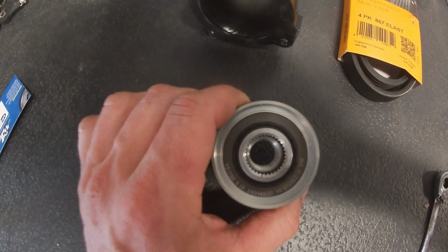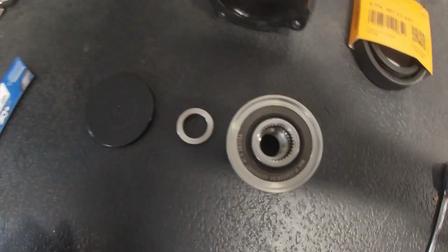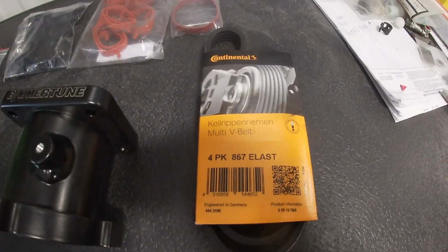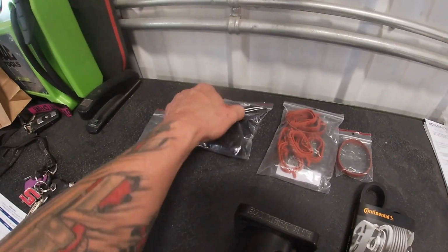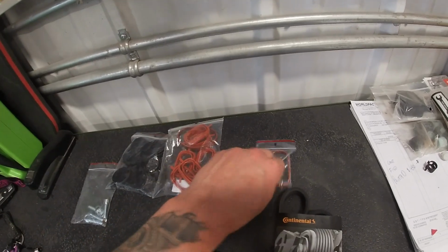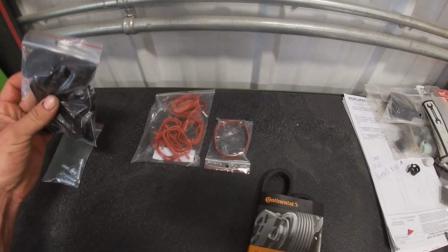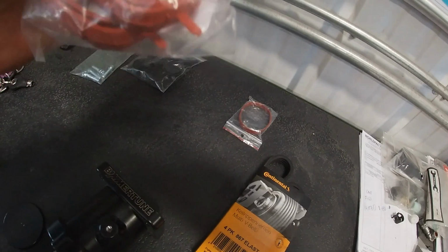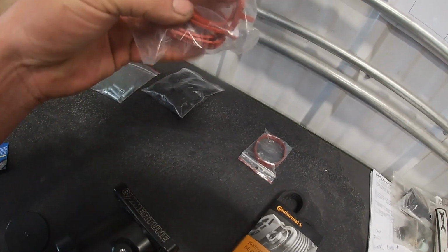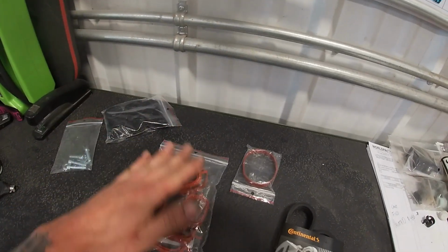Okay, running down on our parts. So we got our EGR race pipe left. We're gonna do our clutched alternator pulley, which we should have done before we put that belt on, but you know, good practice for the next one. We're gonna be doing one right away, so like I said, we'll let the intake bath overnight. Swirl flaps, new intake gaskets. This one is for the anti-shudder valve slash race pipe, it looks like. And yeah, hopefully he's got enough of the, oh yeah, there is. The other side of the intake is just circles, not the squares, so cool.